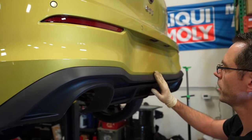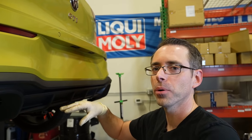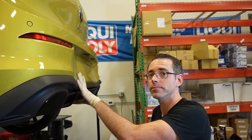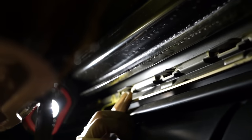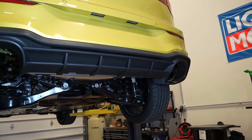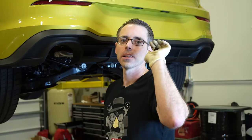So all of these clips — if you look over here, they kind of look like they're in, but I can almost guarantee that if I just pulled this I could pull all of them out right now. So you have to make sure that not only do you get them in, but then you secure and make sure they're latched all the way. Hear that audible click? That means they're in there. You can see all of these are properly in, and as you get here, it's pretty obvious that one's clearly not in all the way. The plastic was kind of stuck on the edge, so it finally sat down where it was supposed to. What you're doing is: push on the bumper side, then push on the valance side — walk your way along. This is what it should look like when you're done. Now we're going to reinstall the hardware.